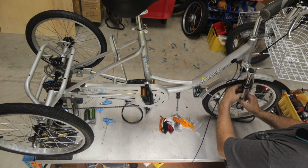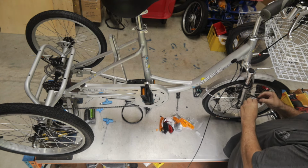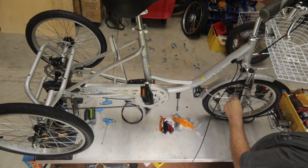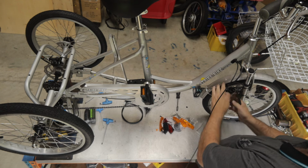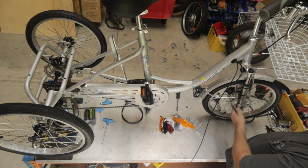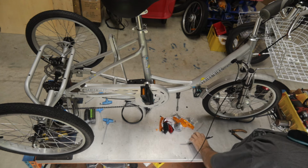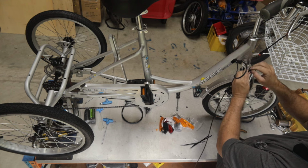Okay, I'm going to push it around behind the front fork leg. That'll give it the protection it needs. And if I can find my little pliers, I'm just going to clip off the extra. When you're clipping these off, make sure you clip them off nice and close. You don't want the tab hanging out on a sharp angle because it will cut you if you manage to rub past it. I'm going to put one more on here because the way this cable is, it's hanging out a little bit. That's just the way the cable is attached and bent.